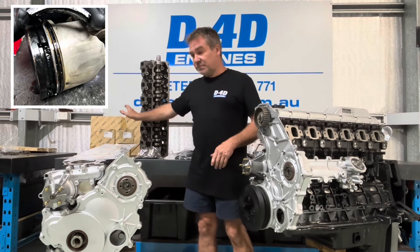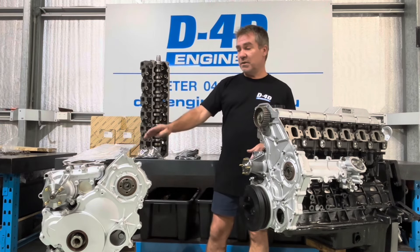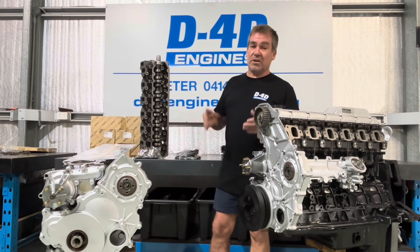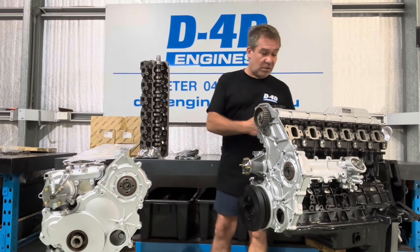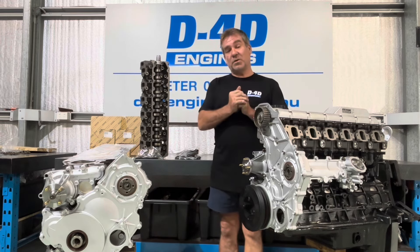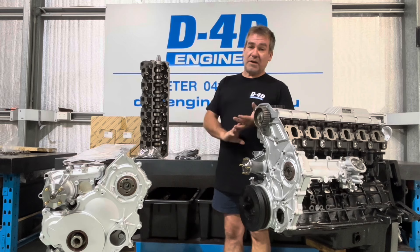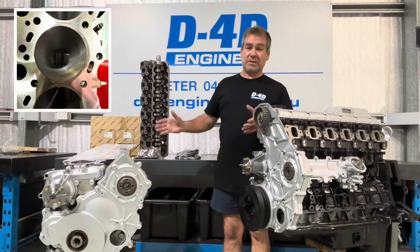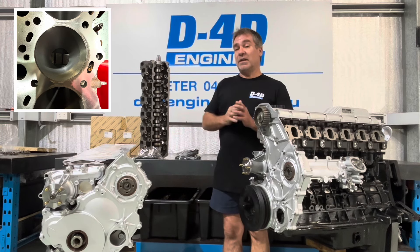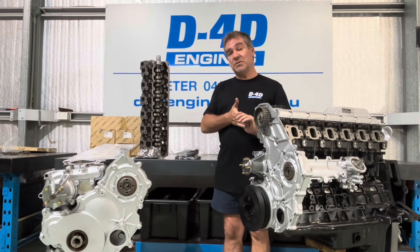Between the pistons, the head gasket, machining the block correctly and accurately with modern equipment, the new cylinder head, head bolts and washers, you're on the right track to get some reliability — you can have a bit of faith in what you've built. I'll go through pumps and whatnot in a different video, but this is just to give you the base of what we do and what I think you should do every single time. You see people put ARP head bolts and just rub the top of the block — you're just kidding yourself. You really need to machine it, get it right, first time, so you know it's right. If there's anyone who can help or you want one done, or even just a standard 1HZ, we do them all — please give me a call, we'll make it happen for you. Thank you.